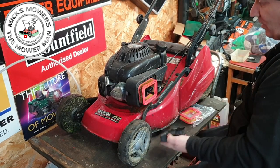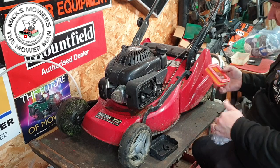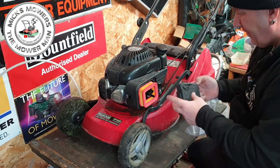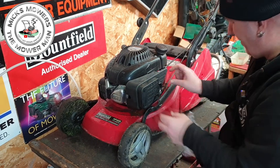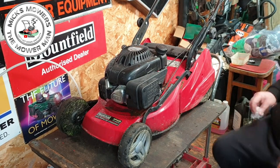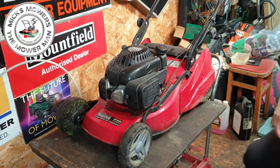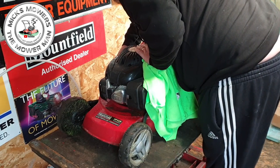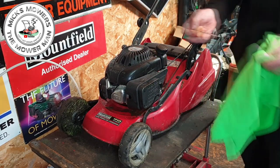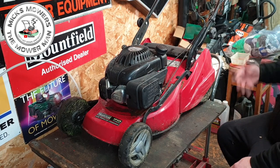Working! I've managed to fix that in about five minutes. Let's move on to the service and get this mower finished. We now have an up and running lawnmower that someone threw away just because they couldn't investigate the reason why it wasn't running. All we're going to need is a new air filter — that's seven pound. The carburettor is absolutely fine. I want to check the blade and check the oil. The oil is very low and it doesn't look brilliant either.